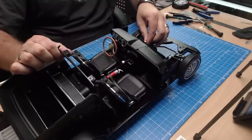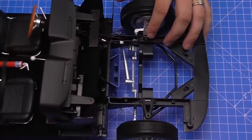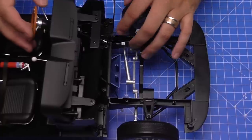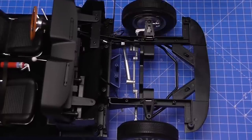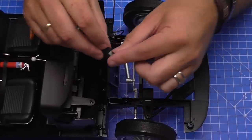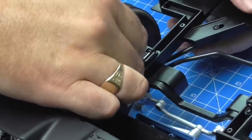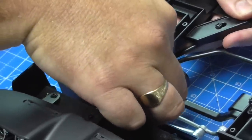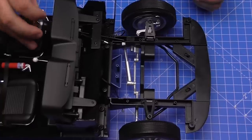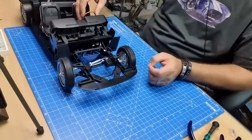Before engaging, you want to make sure the steering wheel is straight and the wheels are also straight. I'm going to push that right down in there. That's now engaged with a perfectly straight steering wheel. We then need to press the pinion onto the rack using the steering column adjuster, which just pushes into this gap to ensure a tight fit. When I turn the steering wheel now, as you can see the wheels turn. How cool is that — to the left and to the right!